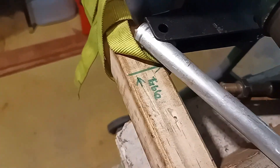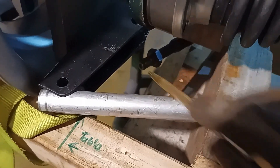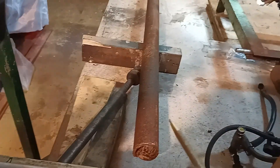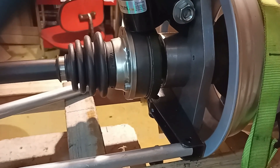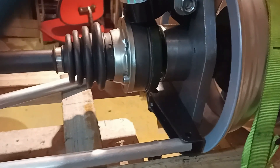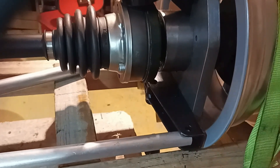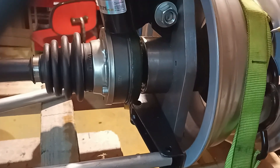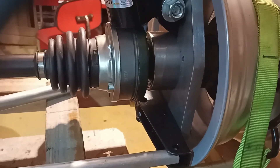The radius rod, although it's a little hard to align in this mock-up, comes through and attaches to the bottom centre mount there, and is then carried forward to attach to a chassis member. This is just mocked up at the moment. Weight-wise, while it's strong, I am paying the penalty of starting with Volkswagen van parts, which are heavy in themselves. The upright, brackets, and hub together weigh about 4.1 kilograms, and when I add in the drive shaft and drive flange — which are quite heavy parts — the whole arrangement is pushing 8 kilograms.